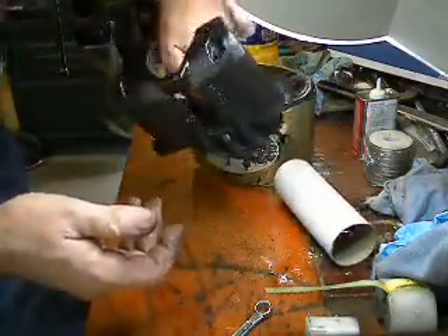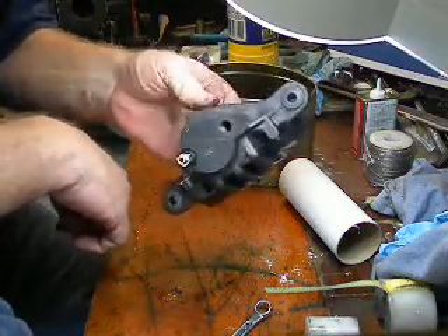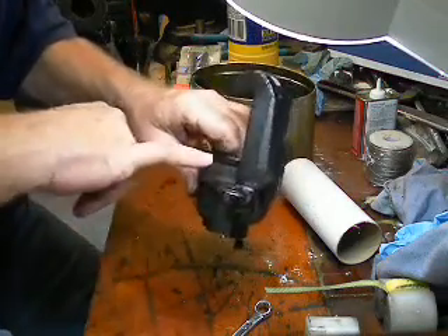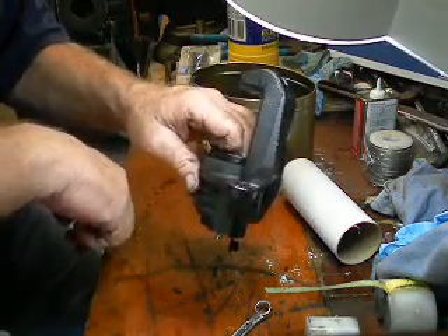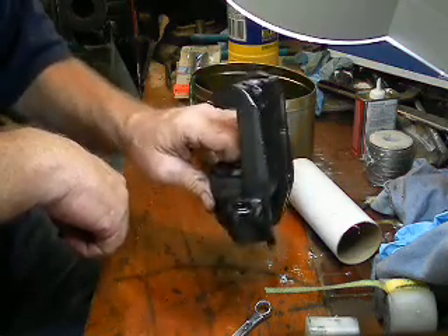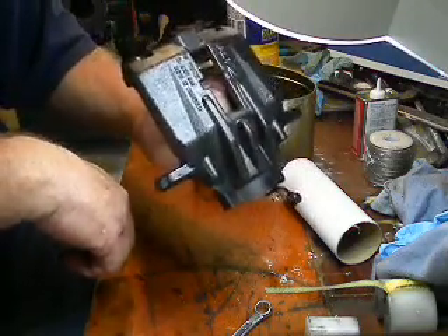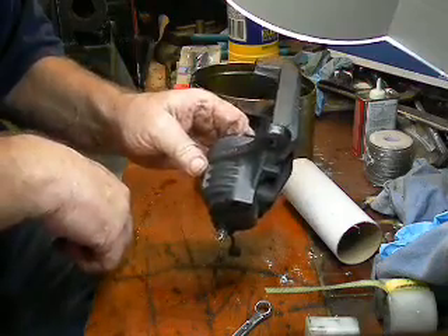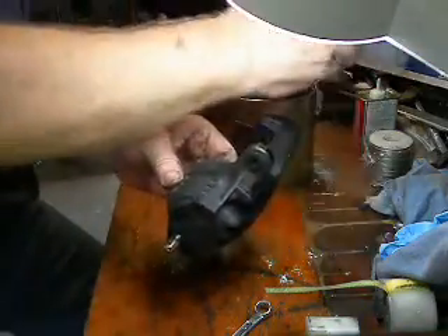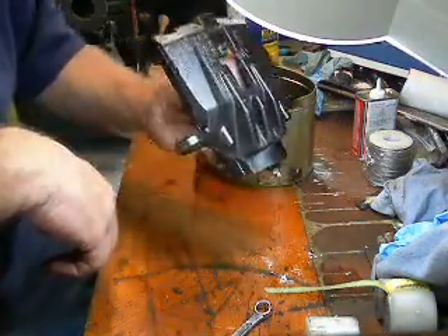And there you are — a rebuilt brake caliper for a 2003 Chevrolet Corvette. Hope you enjoyed this video and it helps you. In my opinion, there's really not a whole lot to a brake caliper: you've got the dust seal, and then you've got that little flat O-ring that seals the piston to the bore. In my opinion, there is no need to spend between $60 and $100 for a new or rebuilt brake caliper when you can buy the parts and do it yourself — it's really not that bad. If you've got to the point where you can do a brake job, you can do this part, believe me. Hope you enjoyed the video, and if you did, please subscribe.